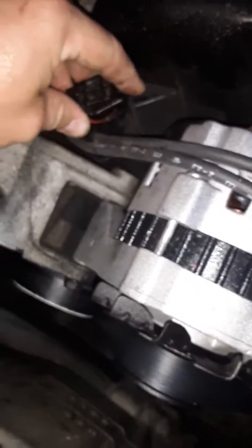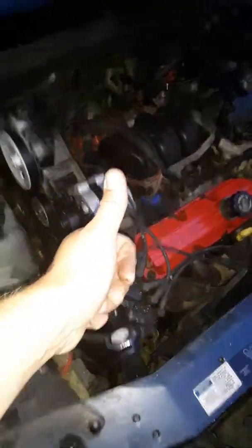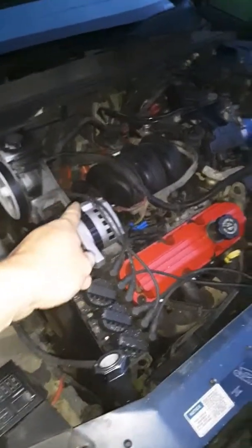So I took some oil, oiled it up, cleaned the crud off of it, and got it working again. I took it down the highway and I noticed I did not smell oil burning. So that was a fix. That PCV valve was stuck.